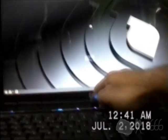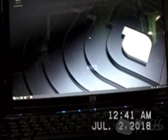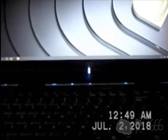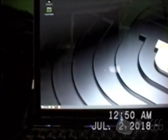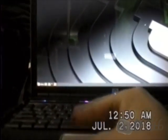I can hear a startup sound. I still don't have any wireless. So that's working great. Let me see if I can get that started. I love easy solutions. What I had to do was install the Broadcom firmware, which is kind of annoying because I did, after all, select that it should install this during the installation process. So I have no idea what it screwed around with during the installation process.